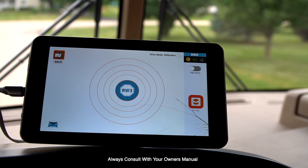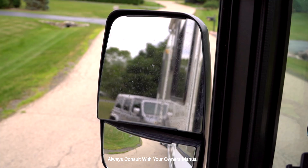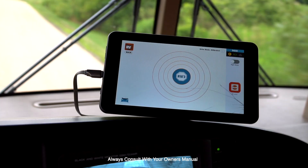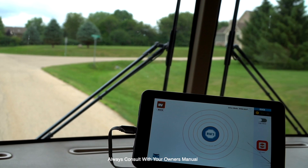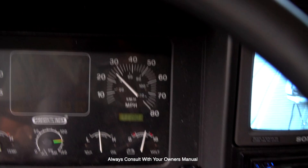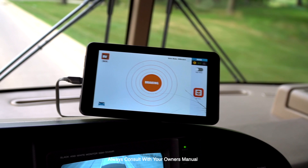The vehicle just trails behind — it steers and does its whole thing. A test you want to do: get the RV up to about 30 miles per hour, push that button as you let off the accelerator. You should feel a slight tug on the RV. If you feel more than just a slight tug, go ahead and adjust the PSI for the brake system. I'm on the road doing about 30 now — I'm going to let off the throttle and tap this button. I feel just a slight tug on the RV, which tells me the setting is pretty good.